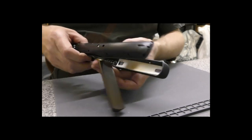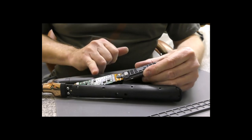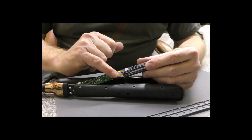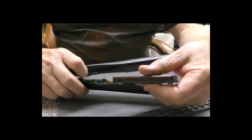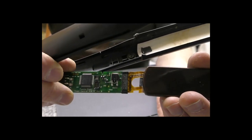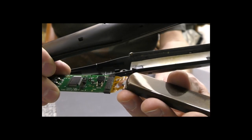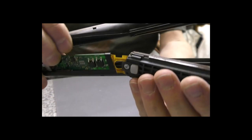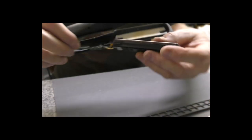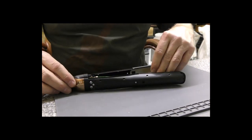Now the reason we don't really want to look at these is because GHD changed from copper wires to this thin film method of wiring everything together. It is extremely fragile, and do not be surprised that when you've taken these apart, changed the cable and reassembled them, that you've got another fault. It's very easy to damage these connections. Really not a very nice thing at all.